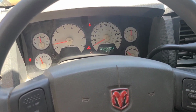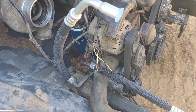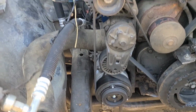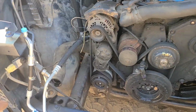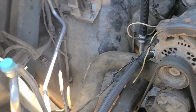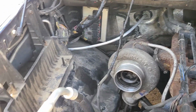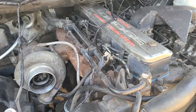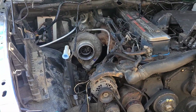Better breakdown once everything's done, and obviously want to get the AC and everything to work. So yeah, the AC is all new. It's all third gen compressor, everything. I'm just waiting to put the condenser in, then I'm gonna hook it all up. I've still got the factory pressure sensor, so all that stuff should work. I got the diesel third gen lines. As far as the AC, it should work as factory third gen. So that's one less drama. You gotta have AC, especially in Texas.